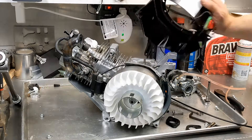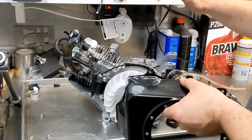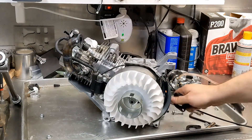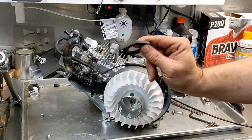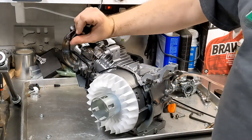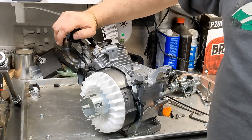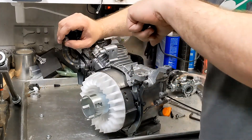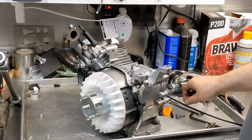Okay, so the airbox has been modified. I've had to cut this large hole into it, but the carburetor should fit now. One thing before we do — I want to show you the carb to intake spacer. The system came with this spacer here. The diameter of the carburetor outlet is about one inch and the inlet to the manifold is a little over three quarters of an inch. So as the air comes in it's going to hit this large step and just kind of get all turbulent and screwy, where we want a nice smooth flow going through the manifold.